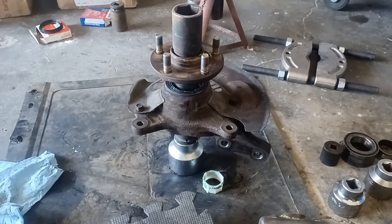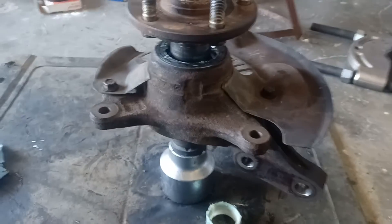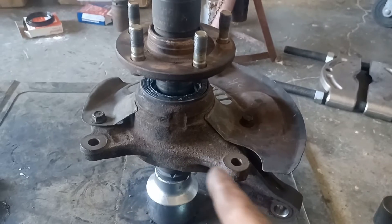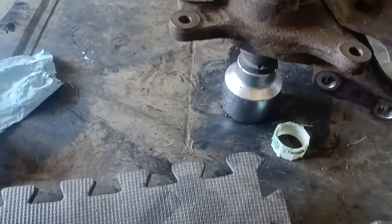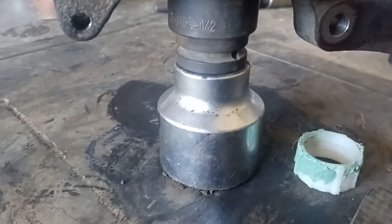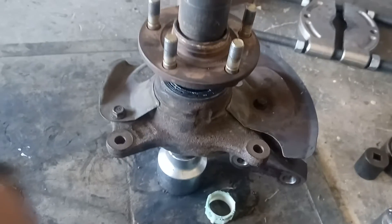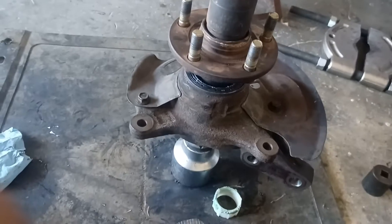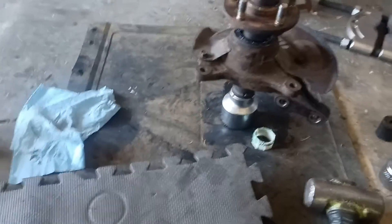We have the seal on the front, the heat shield in place, and we've got the keeper out of the center races so it doesn't hold us up or get squished in there weirdly. We're supporting the back of the center race with an inch and a half socket on top of another one — putting the bearing together on this Subaru Outback hub, same as a Forester or any older Subaru style bearing. Pretty much the same across the board.